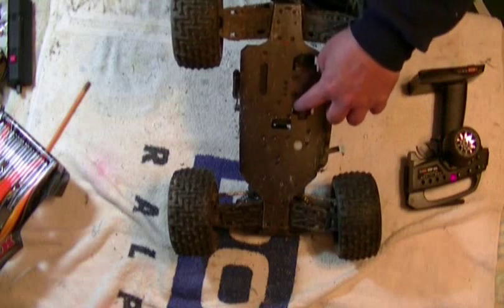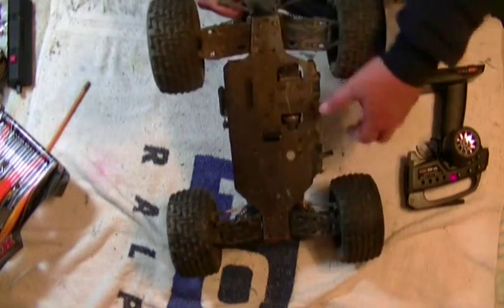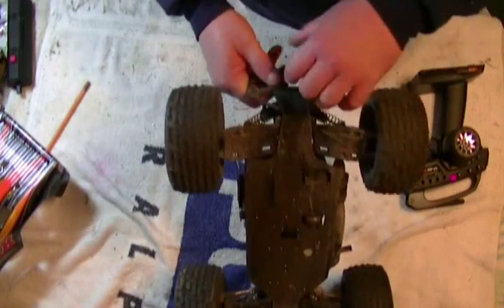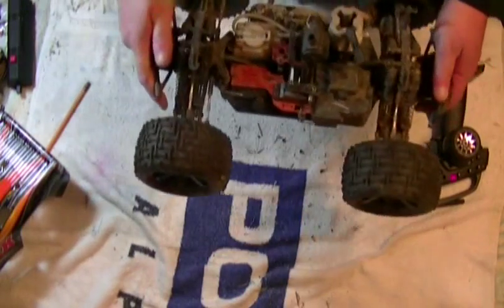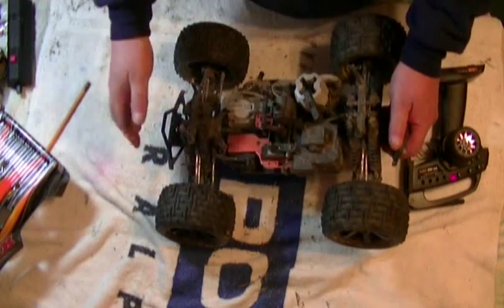Well, this hub wheel right here on your flywheel on the truck, I think you can see it. Let me get a little closer. Right in there, you can see it turning. What you can do on that starter box, you can set this truck on there and push down on it, and it will spin against that and start it.